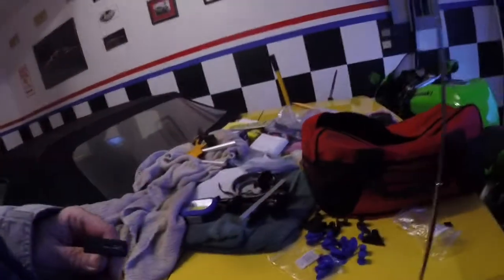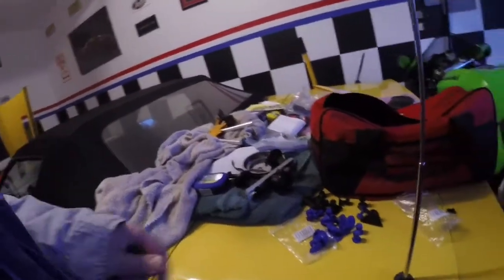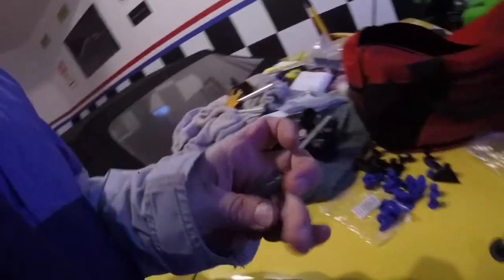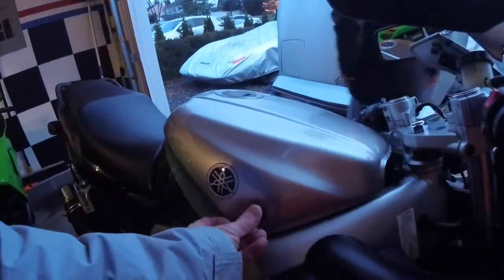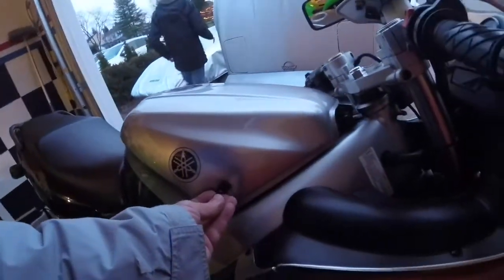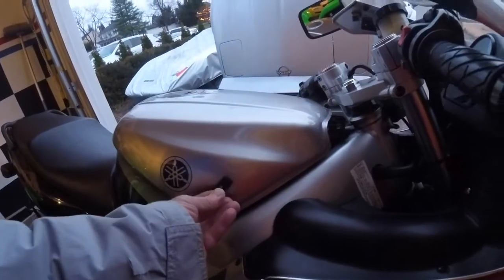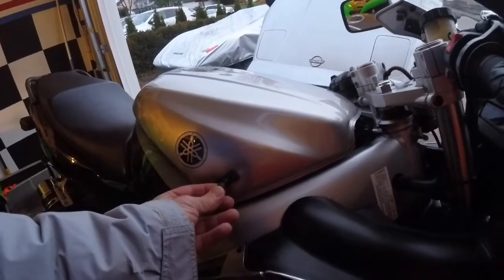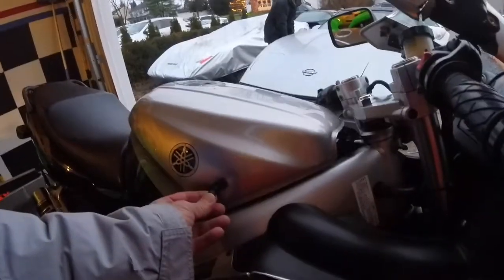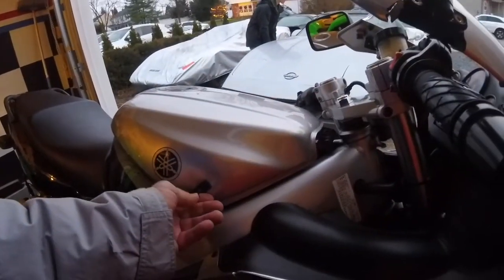My dentless puller kit, or paintless repair, and it seems like this is going to be the longest I have to go across. It's not exactly where I want it. I wish I could go a little bit longer. What I'm going to do is snag it right in the center and try to pull it out. Then maybe I'll have to pull up in here and here, but you want to get it where the main dent was and pull it. So I'm going to try that, see what happens.